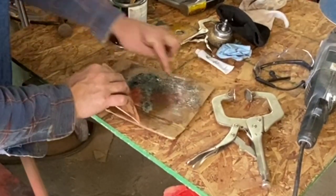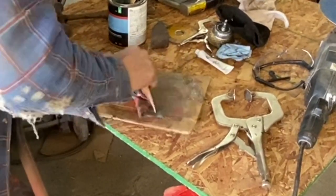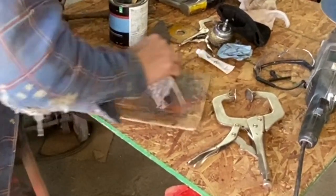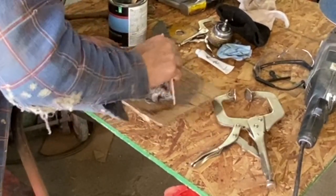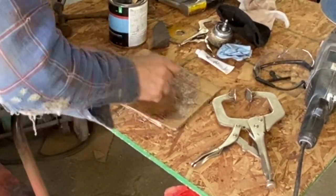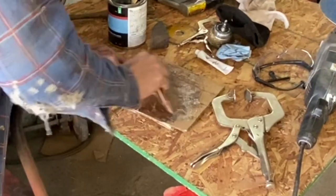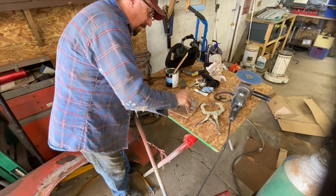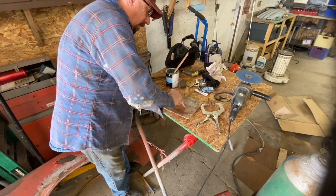So you see that that hardener now is down here on the cardboard, and it's not soaking into the cardboard because I got that layer of tiger hair already on there. So you're going to work it back and forth, spread it across, flatten it out, work it sideways. You don't want to stir it. You want to just keep using the edge, cutting it in, coming back, cutting it in, flattening it out, coming at it from different angles until you've got a good consistent mixture and you know that that hardener is mixed in well into your tiger hair or your Bondo.